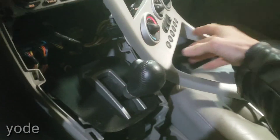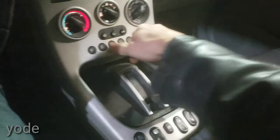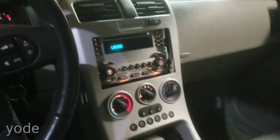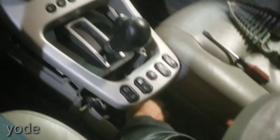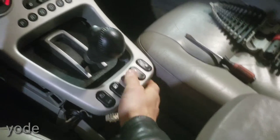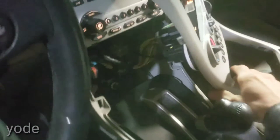Shift it back so the cover comes off like that. Then go under here with a flat screwdriver and try not to damage the edge or the plastic — just pry upward. Then pry up around the whole thing and it will pop out. You have to disconnect the clip down here for the window switches in order to get it to come over far enough.